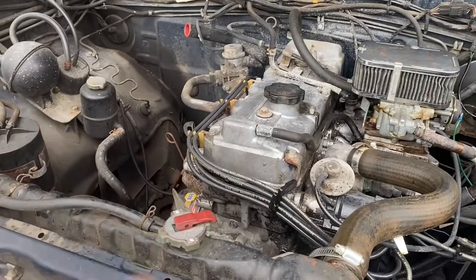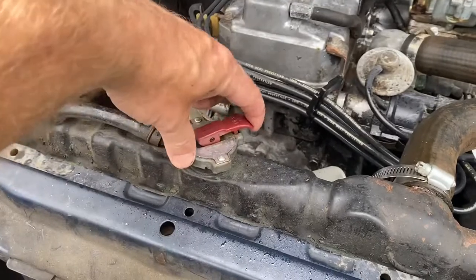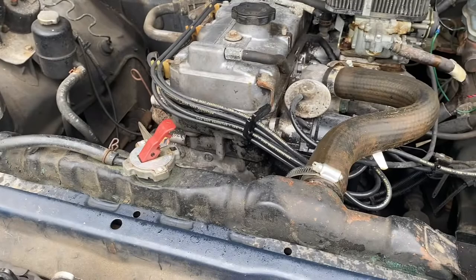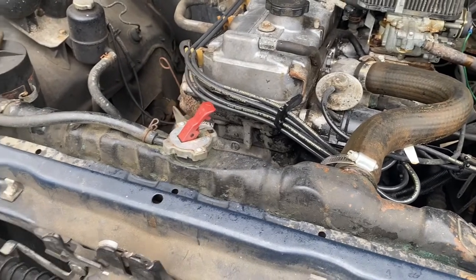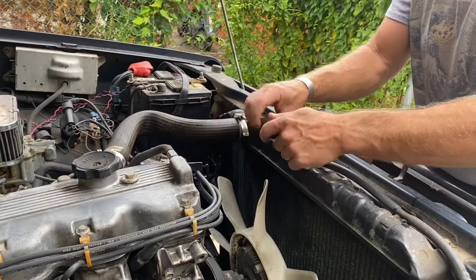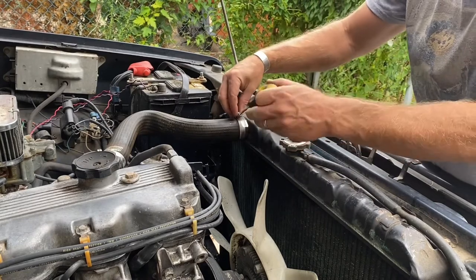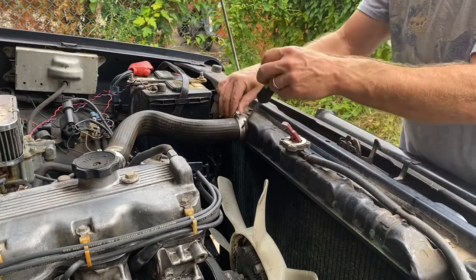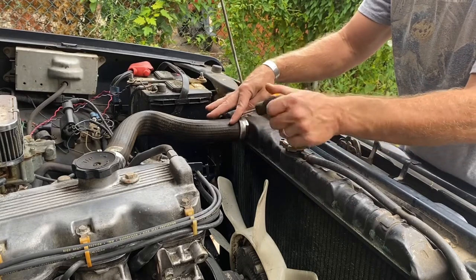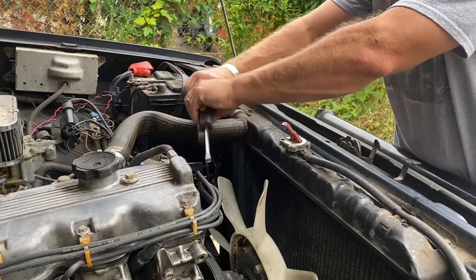There are actually two ways to go about step one. We can wait for this entire thing to cool down and then drain it out, or we can pop that pressure cap, let everything drain back in, and then just go about our business. I did that one. Next step — we do have to take this upper radiator hose out of the way so we can get to the neck of the radiator and get to our leak. That clamp is extremely hot, so that would be the advantage of letting everything cool down — everything will not be extremely hot.